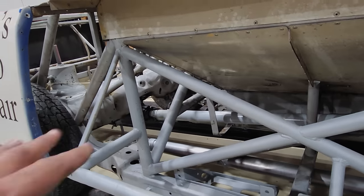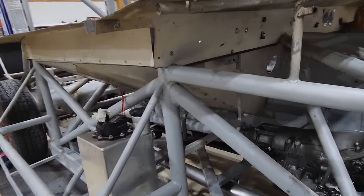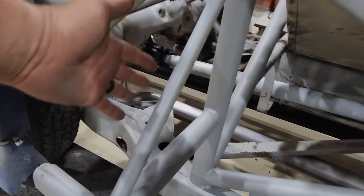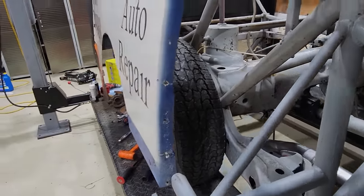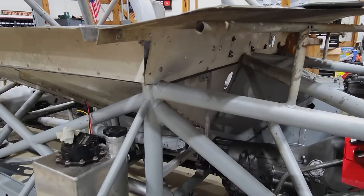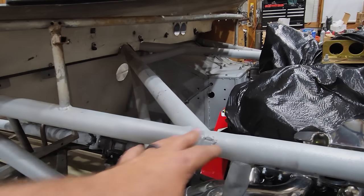We're going to have the electro-digitals here, but I am going to separate the Holley Terminator X — the brains of the whole rig — and put that up here. There's already a frame in there we could probably use. A couple of reasons: there's going to be a lot of shrapnel and stuff flying that could get in here, and if we put it up here we're not going to have to extend any of the harnesses, which is not recommended by Holley and is a tremendous amount of time and effort. The factory harnesses and the generic universal kit should reach the injectors, ignition, and all the sensors.